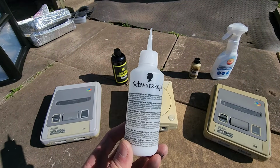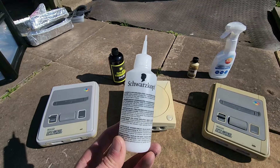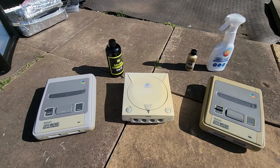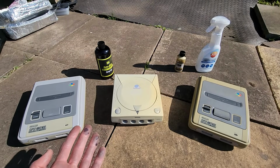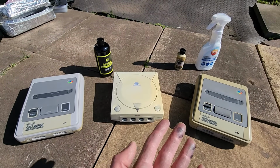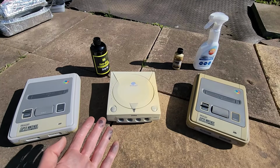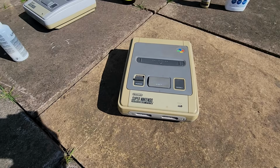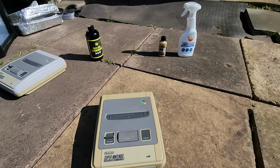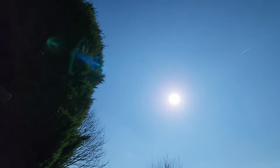There are some instances where submerging your items in a hydrogen peroxide-based solution just isn't ideal. Maybe you have some sensitive components attached to your plastic and they cannot be removed. So let's try a Vaporbrite solution. Now the difference with vaporbriting is that we're using hydrogen peroxide, heat and UV rays, the sun in this instance.